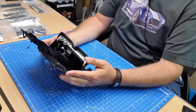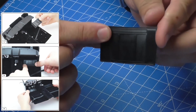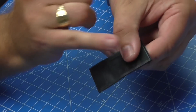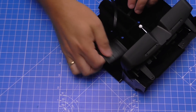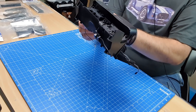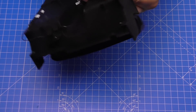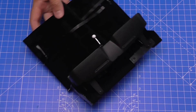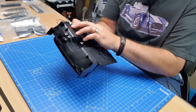I'm going to show you again what we did last time — the gear stick, all the dials and stuff. The first thing we're going to do is start putting in some rubber mats. These are really flexible rubber, they've got some lugs on one side. When we put them on we want the thin edge going under the dashboard and the thicker edge with the detail going towards the chairs. We've got some lug holes just at the back underneath the dashboard to fit these in. It's probably best to line them up, then turn it over so you can see the lugs going through the holes, and just push them in.